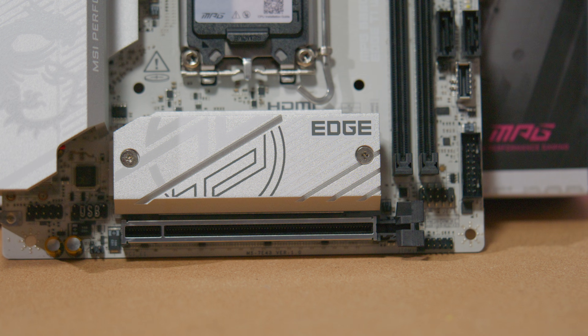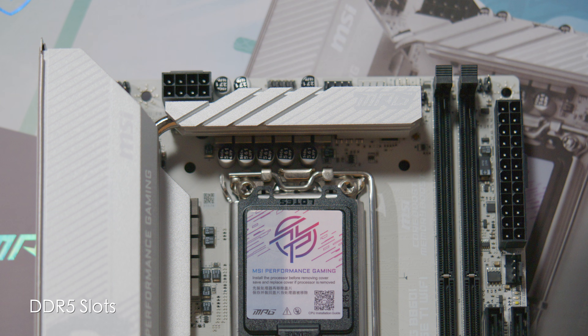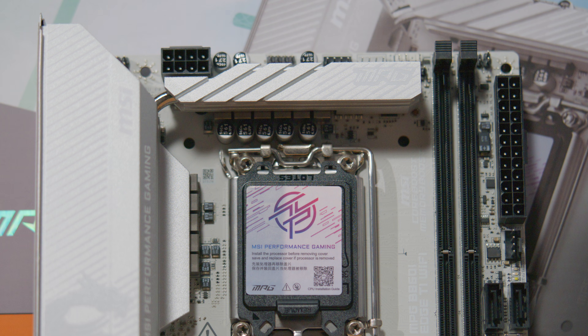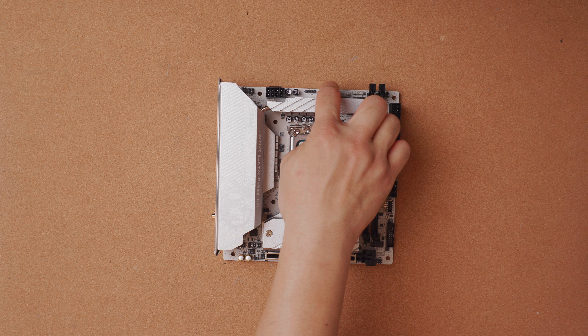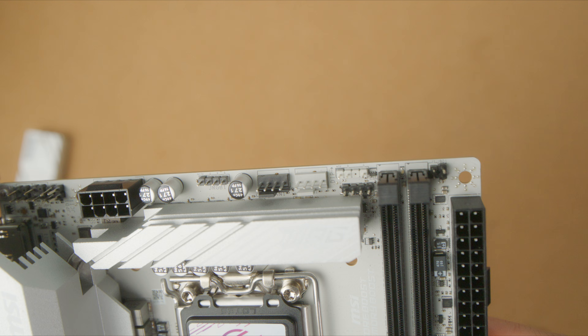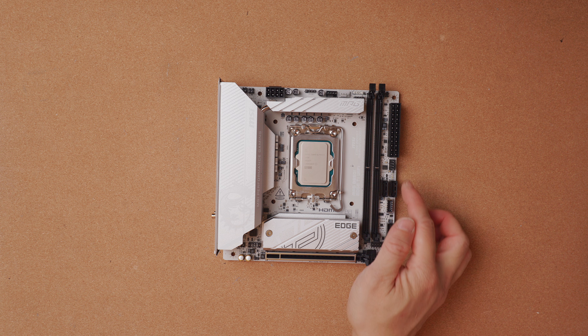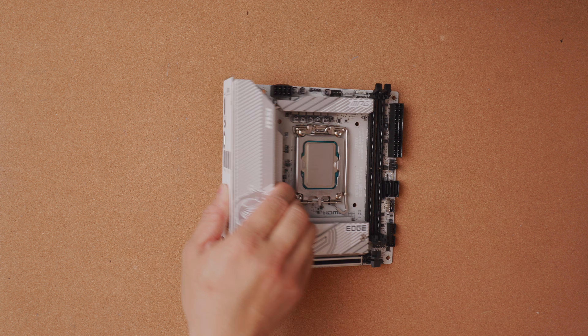The expansion slot here is Gen5 — nothing fancy, just press down to release. There are 2 DIMMs, and 6400 to 8600 megatransfers per second is possible as an OC. You have two SATA data ports, a Type-A 5G header, and a 10G Type-C header. Fan headers at the top include CPU and pump headers rated at 2-amp and 3-amp respectively. The Sysfan header with a 1-amp max is south of the 24-pin motherboard connector, which is a nicer setup versus the B850i. You also get RGB headers at the top.